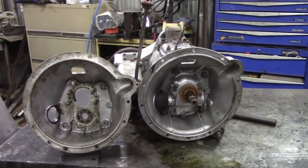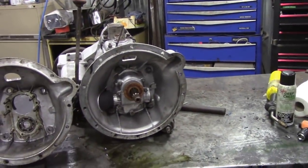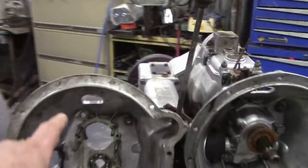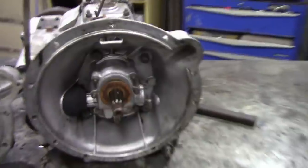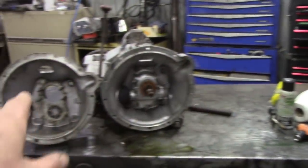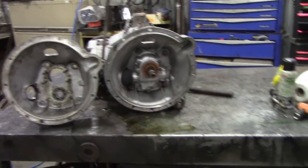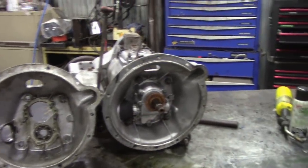So this is what I was talking about. On here is the six-cylinder bellhousing, over here is the four-cylinder. Pay attention to the bolt pattern — it's different. The starter nose, where the starter goes in, is higher on one and lower on the other. So that's why we can't just swap off the cover, because it just won't fit.